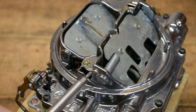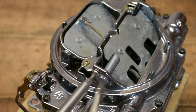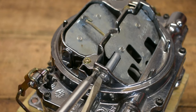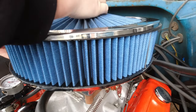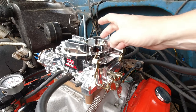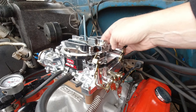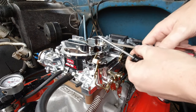You can also change the metering jets in the back — that's another way of doing it because it helps draw more fuel out of the fuel bowl and into the venturi and down into the carburetor. But jet size and how much fuel is going in there is a little bit different from the timing, and that's what you're trying to do with this air valve — get the timing right.